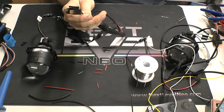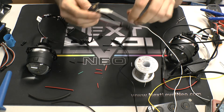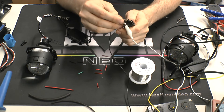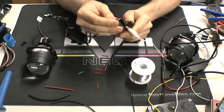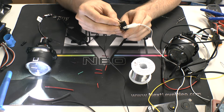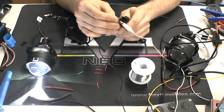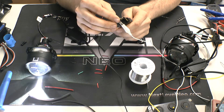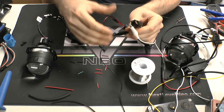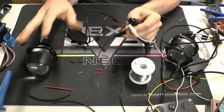So now you can see with the projector — all I do is connect my constant 12-volt and hold my ground here. The power is on and you can see I have low beam. And then when I remove that ground and go over to my high beam, I have the low beam and the high beam active at the same time. And it will not back-feed. So I don't have to worry about any issues on the car — lights on the dash or something like that. This should make it all work properly, unless your car has some kind of a resistance measurement, then you might have an issue. But at least on the Foresters, this works pretty good.